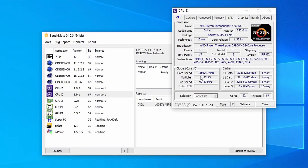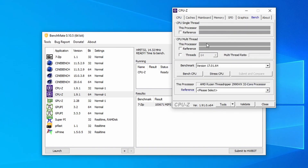Right now we're running at 4275 MHz at 1.375 volts — pretty spicy frequency and voltage. So let's give it a roll. And sure enough, we've got a stable run. We were able to get some valid results. We got them submitted over to the hardware bot, and we managed to land in eighth place. So we beat two people — that's awesome. Proud of that result. Let's see what Cinebench R20 does.